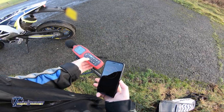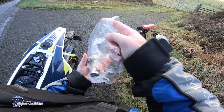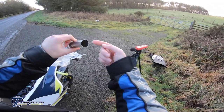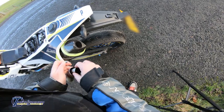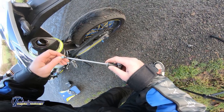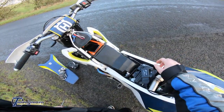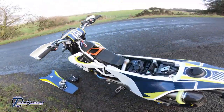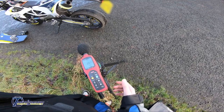Let's put the baffle in. This is the large baffle that comes with the Vance & Hines exhaust, but it's a slightly smaller diameter and it's got a big chunk on the end just to slow down the gas even more. Slotting this back in. One of my listeners said I should see how loud it is on the redline or on the limiter, so let's do that before I put this in — 123 dB there we go.